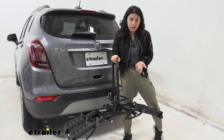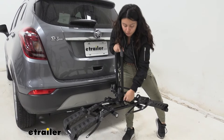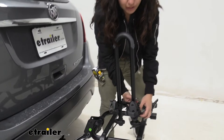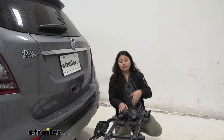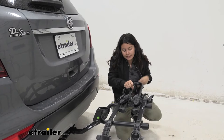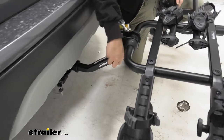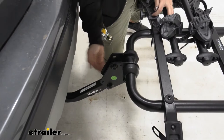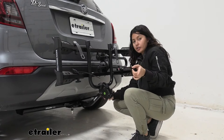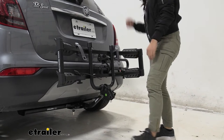You can make this even more compact. When your bikes are off and you just want to drive around town without removing the bike rack, you can fold down the mast. Take that knob, turn it just enough so you can move the anchor, then tighten that knob back down — don't completely take it off. Lower the mast, and from here you have different options: you can use your frame mount straps, or use the wheel straps to secure that mast in place. Once that's done, fold it up by taking this clip out, which allows you to take this bolt out. With that out of the way, let that hang, lift this up, and pop that bolt back in to secure it — very important because it holds your bike rack in place.